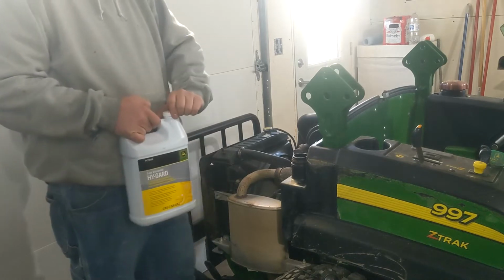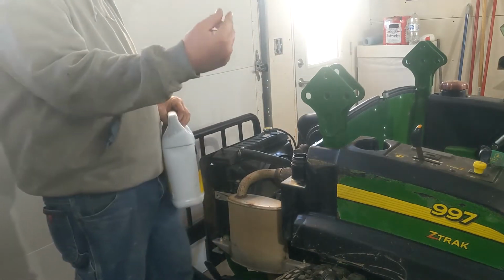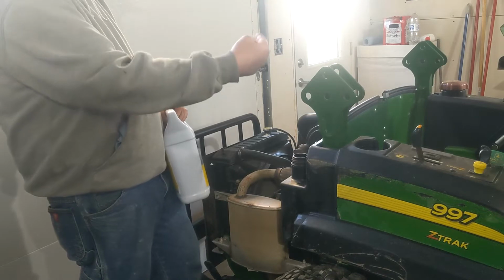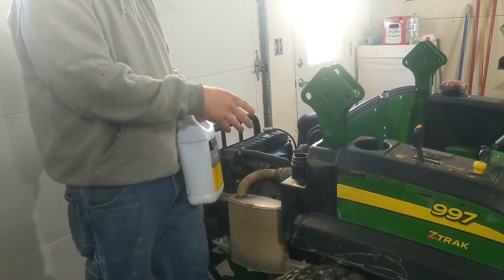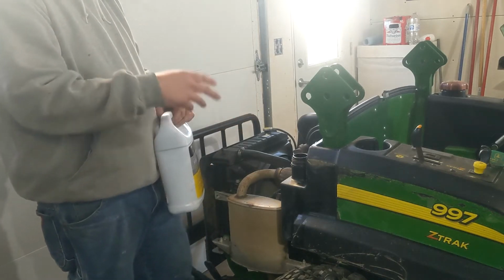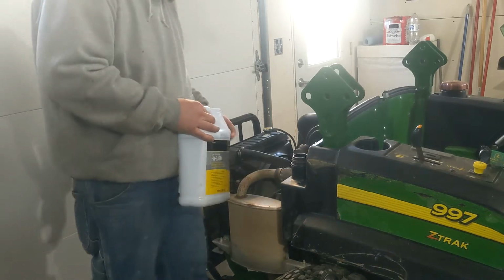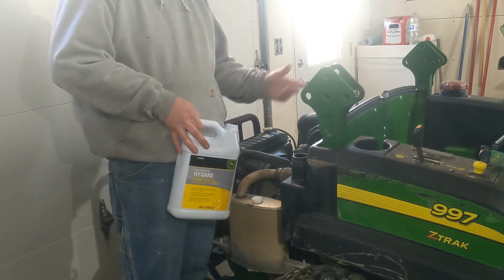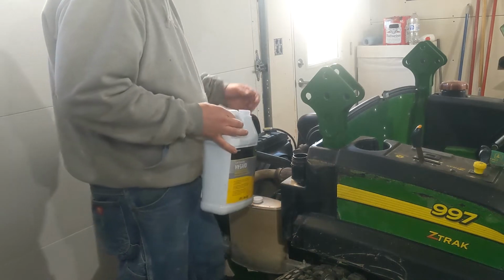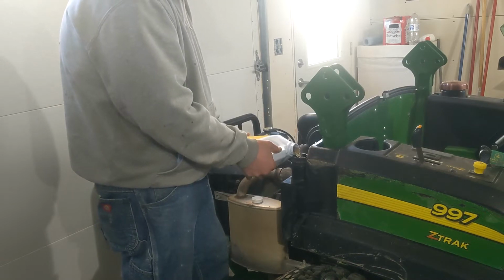So we got our drain plug back in. That was a real fight. It's clear up in there. It's hard to get your hands in. The lines are in the way to where my fingers aren't long enough to get up there. So you have to put it up there with an extension. And you need to be pretty careful because a buddy of mine had a 997. Sounds like it got a little cross-threaded. Tried taking it to the dealer to fix it with chasing the threads or whatever, and well, they ended up splitting the case with the tap or whatever. It ended up costing him and them money, I think. Just take your time, make sure you get it threaded up in there, because all it is is an aluminum case. I mean, it's nothing freaking special.